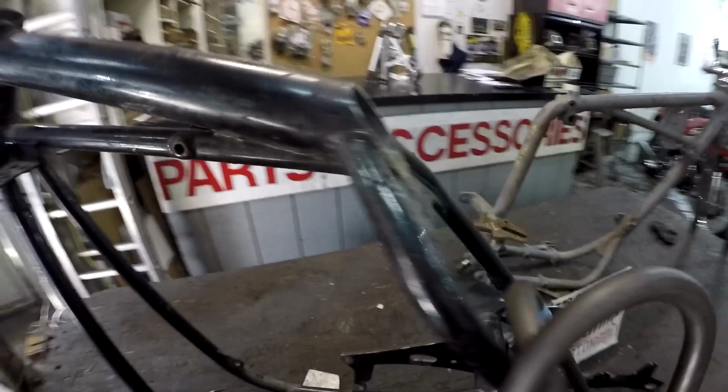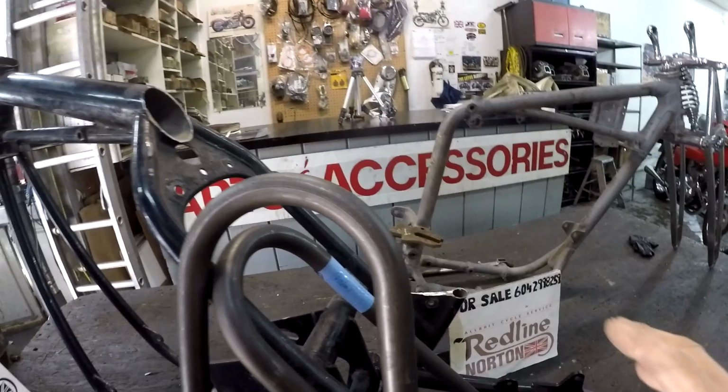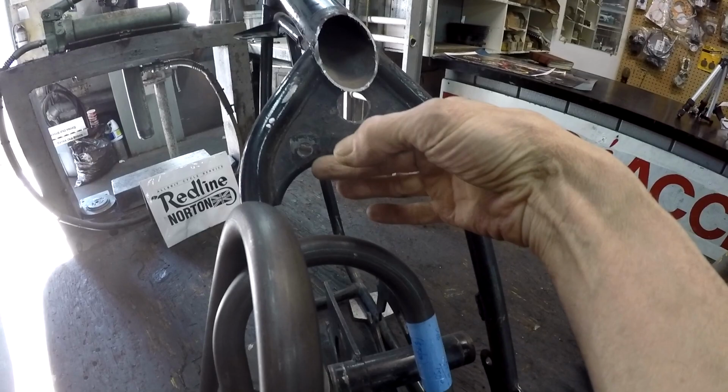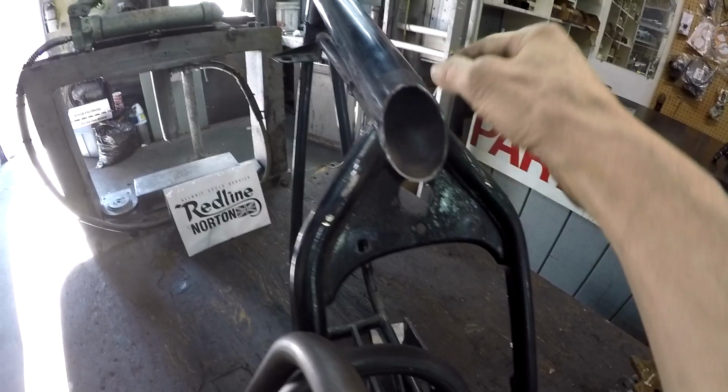The oil tank will go down here, a triangle oil tank, finned, chromed. I've done it before in 1980 on an electric start. It sits on a battery box platform here with two exhaust grommets. And then at the top of the oil tank mount is the breather hose, 3/4 inch ID, a huge breather hose, hooking up to a piece of 3/4 inch pipe that's welded to the frame, and then rubber hose running up to a filler here.